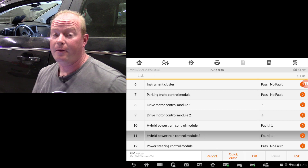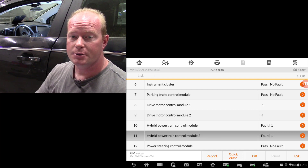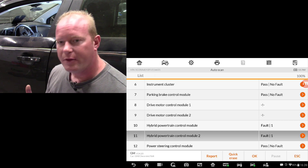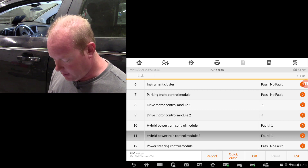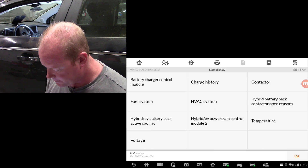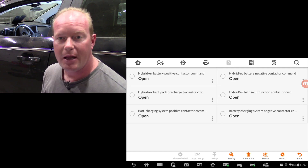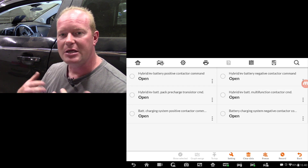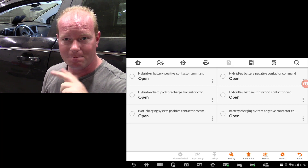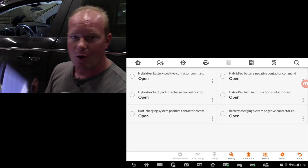Let's go into the inflatable restraint sensing and diagnostic module. Notice there are no codes in there, but the VIN number does not match my car. My VIN is 6631 — this module shows 6753 — because I took the airbag module out of the other car to try to save $300 and not have to buy a new one. That's not going to work on this particular car. This car wouldn't start during the key immobilizer process because the car was in a wreck. We have to think about protecting first responders — this is a high-voltage vehicle and we don't want them to get shocked. The car disables all electrical systems whenever the airbag is deployed. Going into hybrid powertrain control module 2, we can see in the live data under contactors that all the contactors are open. Even after trying to reset the airbag module, it's still open because the module for this car is incorrect and has to be relearned. We'll have to go through that process using the J-Box and a laptop — that will be part two of this video.